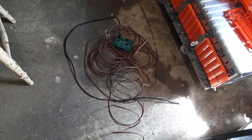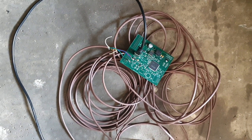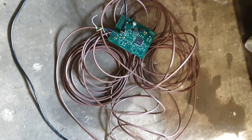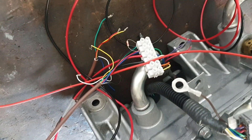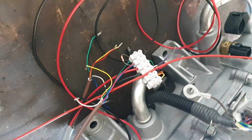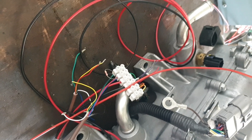So let's give you folks a little bit of a tour here. I've just got a random board here that I think was for a BMS project I was working on. It's just got a SAMD processor on there so I can just program it with Arduino. At the minute, the only connections to it are a USB port and CAN high and CAN low. CAN high and CAN low go through this super long cable here until they come up and go in here to a piece of connector block. The only connections we need to make to this inverter to get it to run are basically 12 volts, ground, CAN high, and CAN low.